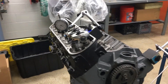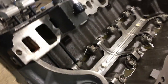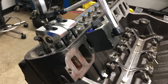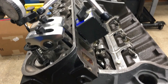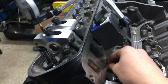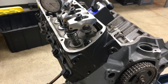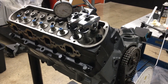This setup is using hydraulic roller lifters. All I did is take the lash out of the pushrod, but I made sure I was not compressing the plunger inside the lifter, because that will affect your measurements. I just tightened the top until I had no lash. I also have lightweight — very small — springs that are technically just keeping the keepers inside the retainers.